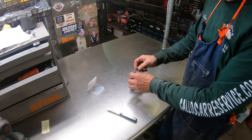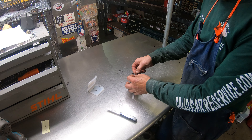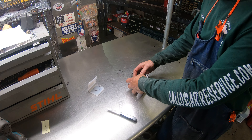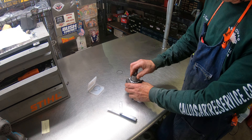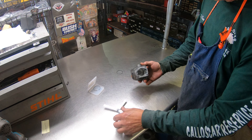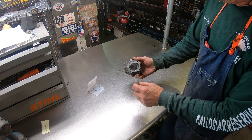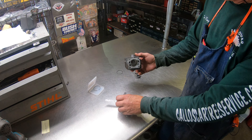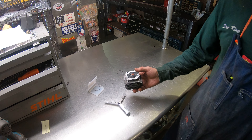Got a brand new ring, OEM. I'm going to do the same thing — use the piston to square it up again. Reach in there, and this one's specced out right at 0.005. Nice and tight. That way you can tell how much wear you've got on these.